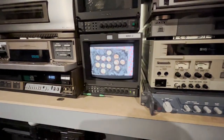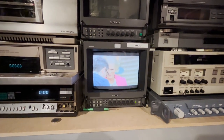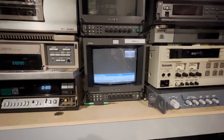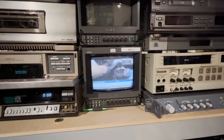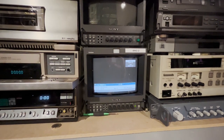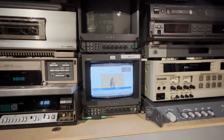I've managed to get a signal on the Freesat receiver built into this Blu-ray recorder, but the signal quality is absolutely awful. It doesn't even look like this Freesat LNB is ready for the new frequencies — I think it's a very old LNB from 10 to 15 years ago. So I got a bit snapped on that order; the person who sold it was very lucky. Basically it only works on the older MPEG-2 format channels — I guess I have to accept that and upgrade the LNB.